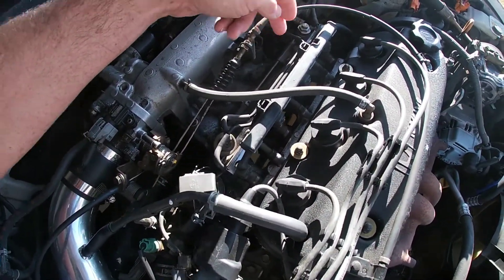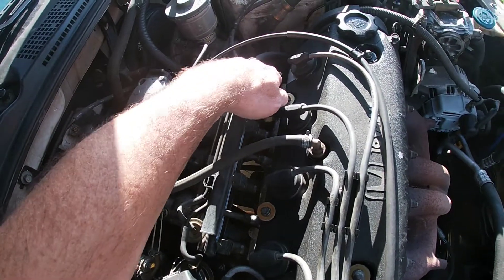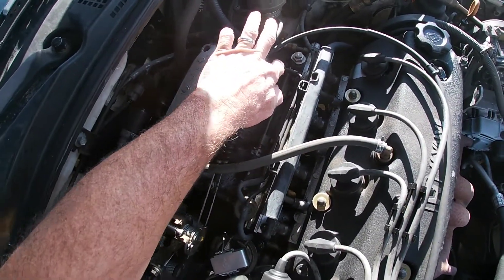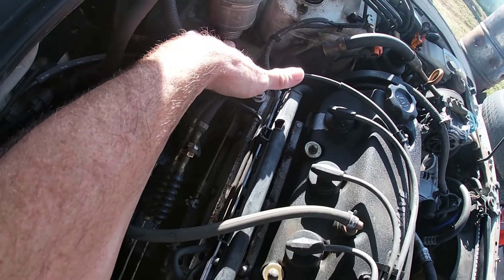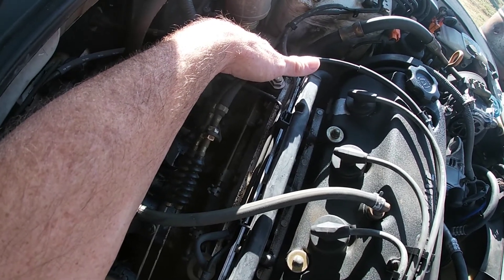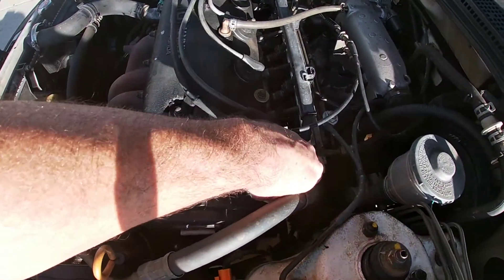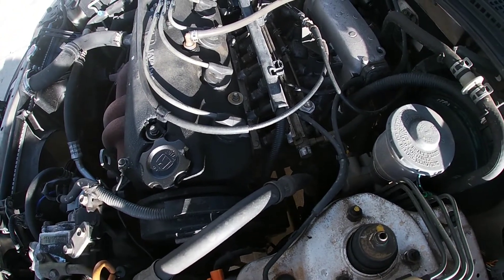This really isn't that hard of a process. You have these three bolts right here — one, two, three — you can see them on the back side. We've got hoses here and a hose back here, several hoses that are connected up, and we'll go through those as we disconnect everything. We're going to take those three bolts off. The main thing we'll have to worry about is fuel pressure — there's going to be some fuel pressure on there. We're just going to break this nut and leak off that fuel, so be prepared for that. Other than that, it's a pretty simple process.